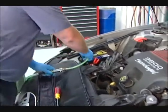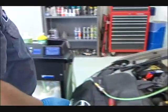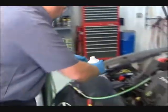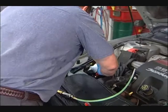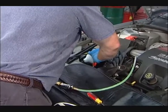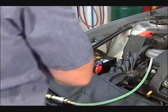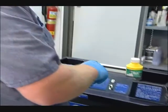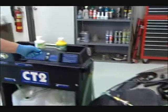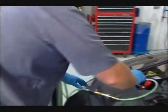At this point, we're going to add our conditioner — it'll be our Super Cool. That was enough to top off our radiator. If it wasn't enough to top off our radiator, we'd just use our suction wand and basically put it in there and return the vehicle until we were satisfied with the coolant level. I'm satisfied with the coolant level.